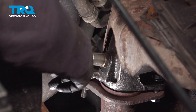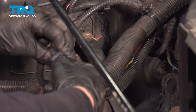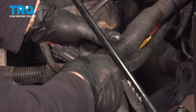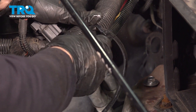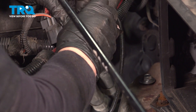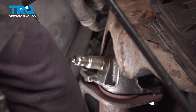So now we're going to remove our O2 sensor. We're going to follow that wire right up to where it's connected, push down on that tab and disconnect it. There's a nice little plastic tie here that someone ran it through. I'm going to reuse that because I don't like the O2 sensor possibly falling down and hitting that manifold, so I'm going to take it right out.